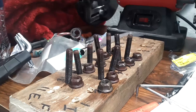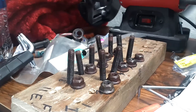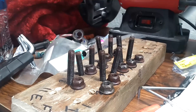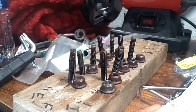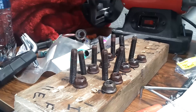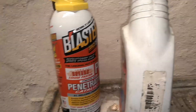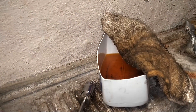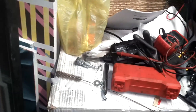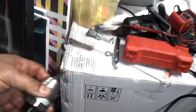In this little video I'm going to tell you how to get the nuts off of the exhaust studs. Usually when you pull the cylinder head and undo the exhaust manifold, the nuts will stay on the studs, primarily because of rust. What I usually do is take the stud with the nut on it, drop the washer, and make a little miniature bathtub of PB Blaster or some kind of penetrant that will remove rust and loosen bolts. Soak them in there for at least 30 minutes. When I take them out, I screw them into the stud remover — this tool costs about $15 or $20.